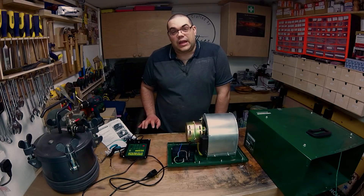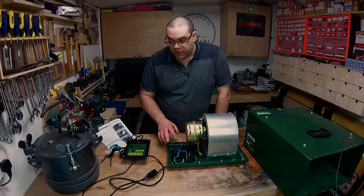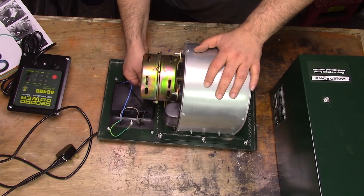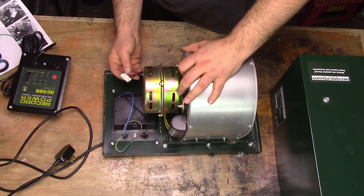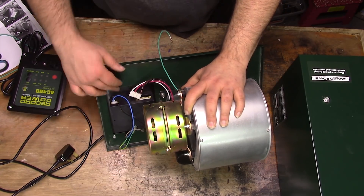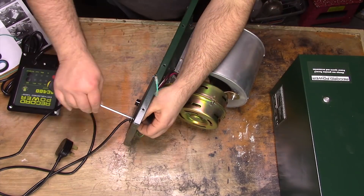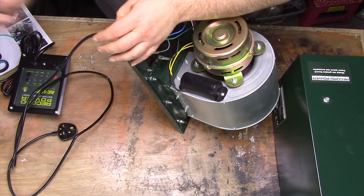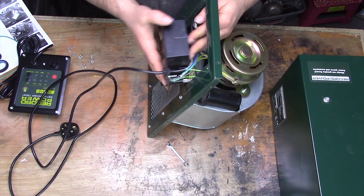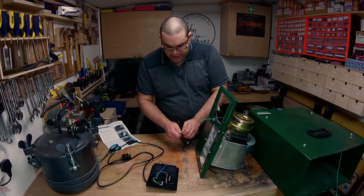The second one is the one from the housing on the outer case. The instructions aren't overly clear on the next stage — they talk about removing the PCB from the control panel board, whereas we've got the complete replacement part here. So what you want to do is disconnect the motor, which is with this coloured red, black, red and white clip at the back here. Then we can undo these four screws and remove the panel. With the last screw removed, I can now remove the whole panel. The new one has some screws on it so I'm just going to remove those.